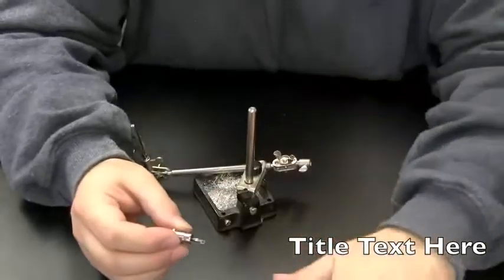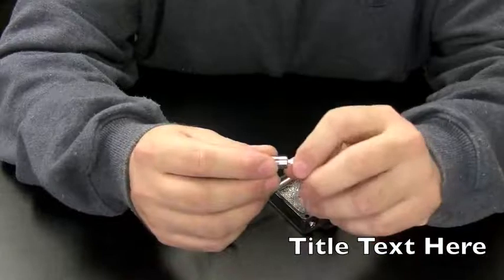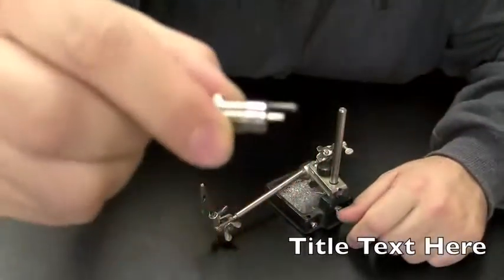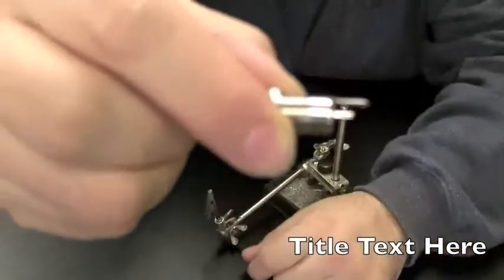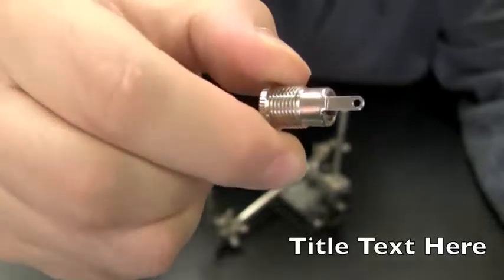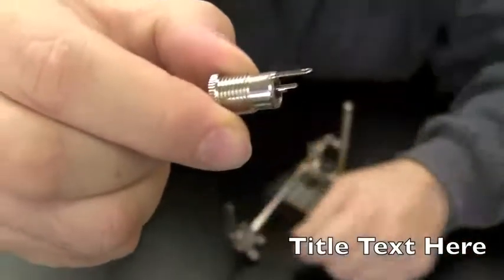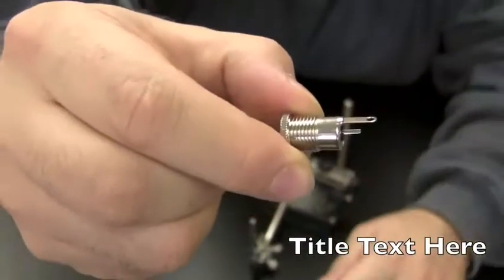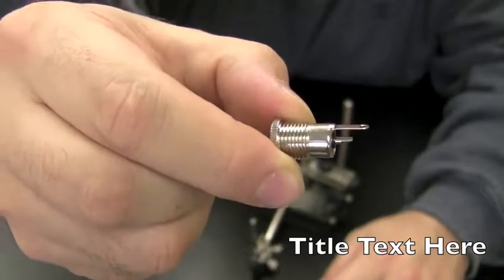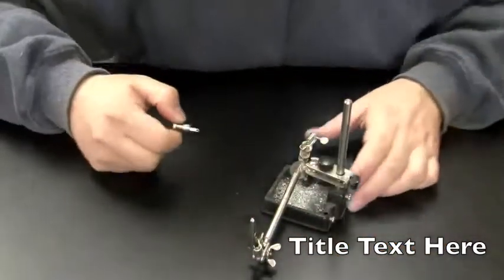Okay, the batteries died in the power drill, so there is some other stuff we could do in the meantime. Here's the power jack. First of all, I'm going to make that pin that's sticking out here a little less long. Shorten it up a little bit just so it doesn't go jutting into the machine. You want to keep these pins as short as possible. Then we're going to scuff them up so the solder sticks to them, and then we're going to attach positive and negative wires to that. So when we put it in the computer, the wires will be already set, ready to solder.